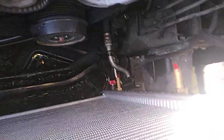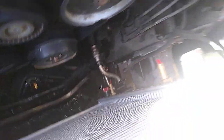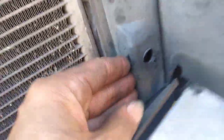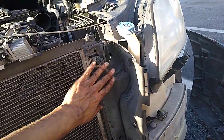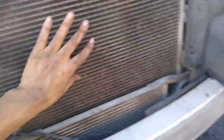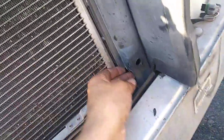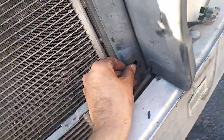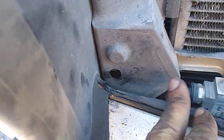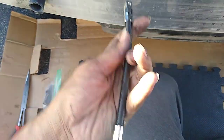However, because I don't have a way of recharging the AC system and don't want to pay another $500 to do it — this is the radiator shroud, it holds all the radiators, the condenser, transmission cooler line, and the radiator. I drilled a half-inch hole there and there, and that gave me access for my tool. This is the flexible 3/8 ratchet extension.